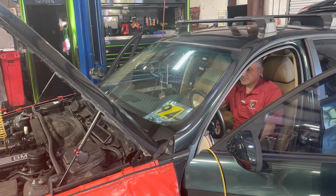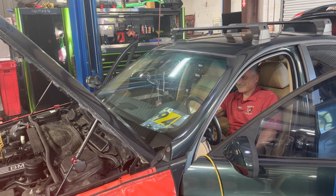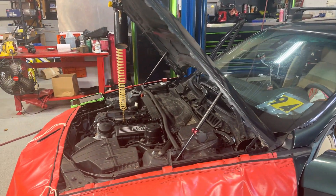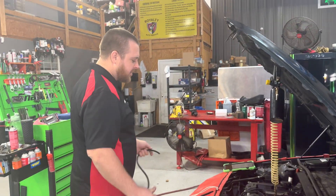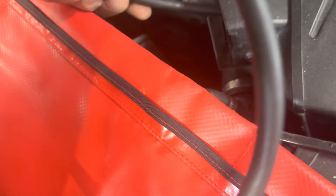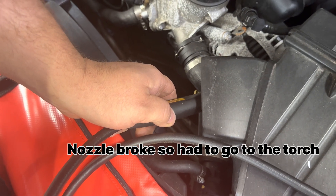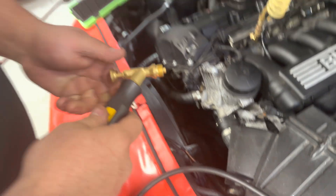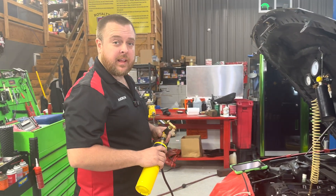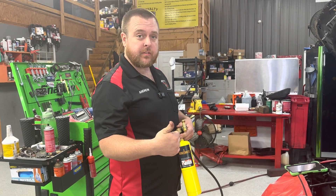You've got to press the clutch for manual. There's still a little in there, try it again. So we've got a no start condition, so we'll add alternative fuel into the intake. We can see it tries to start on our alternative fuel. So that tells us we've got spark and all the coils are functioning the way they should. So now we need to start looking at the fuel side of things.